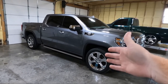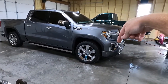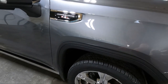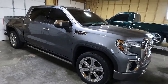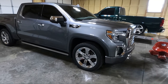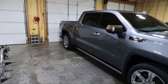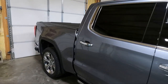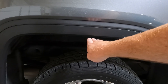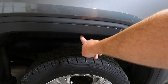I'm going to grab a tape measure and get a measurement from the center of the wheel up to where the plastic starts — from the ground in the center of the wheel up. There's a little bit of variance. Driver's side front we are at 35 and three quarters; passenger side front, 35 and 11 sixteenths. In the back there's about three sixteenths of an inch difference on the passenger side — 38 inches on the driver's side, 38 and three sixteenths on the passenger side. You need to be sitting level with it to get an accurate measurement.